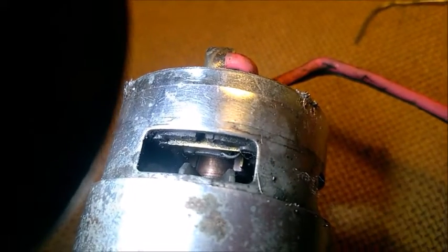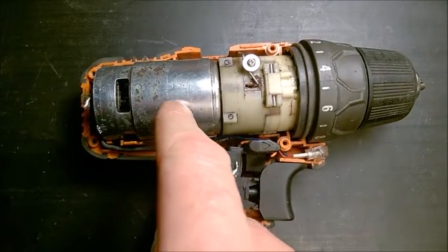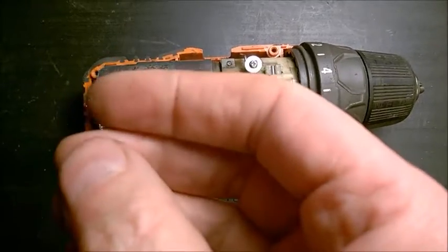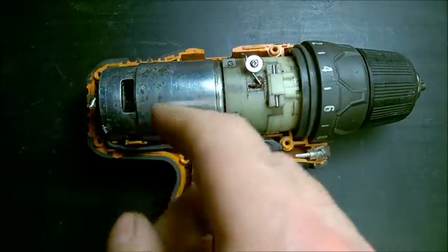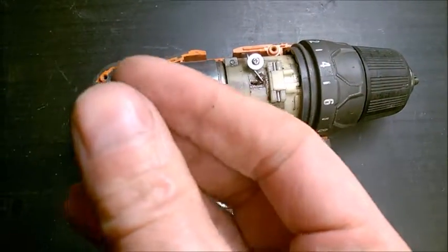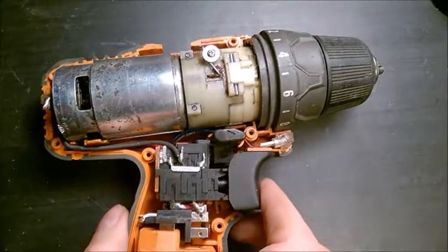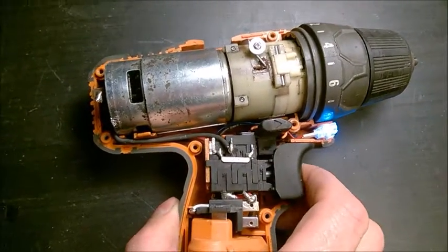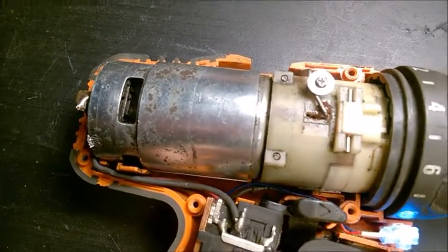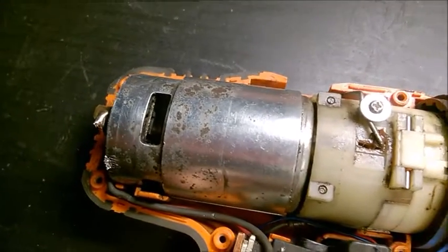Let's give it a try. What I found is it's better to rotate and spin it slowly at first — if you go fast it may still make smoke, perhaps because the surface of the rotor hasn't yet matched properly with the brushes. Try not to put your fingers on it. Let's move it slowly — you may still see a tiny, tiny spark.